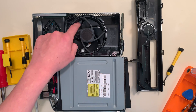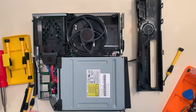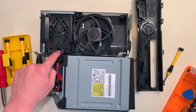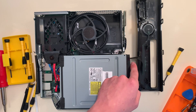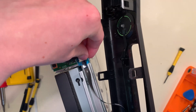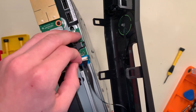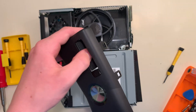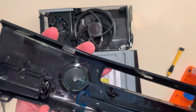This big gray box is the disk drive, and that's the fan, which covers the heatsink. Under the heatsink is the combined CPU/GPU. All of the ports and connectors are over here, and then this is the hard drive bay. If you have a hard drive, it slots in here, and then this is a SATA connector that goes into a slot on the main board. I'll tip the console on its side and take off the blue plastic latch, then wiggle this tan connector out with a fingernail and pull out the ribbon cable. This thing has the little USB cover flap and the awesome touch-capacitive power button.